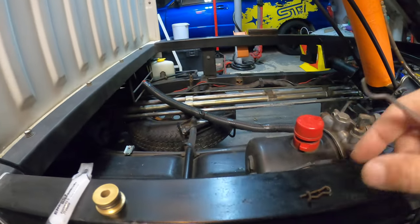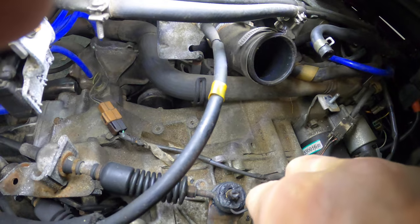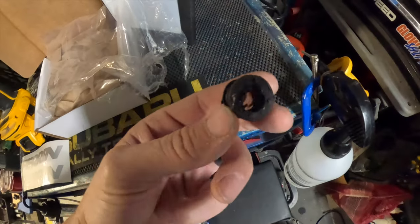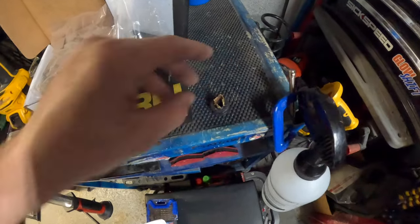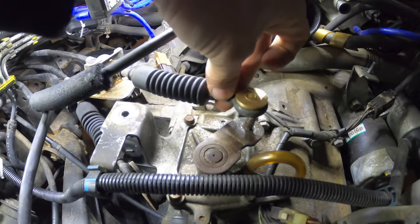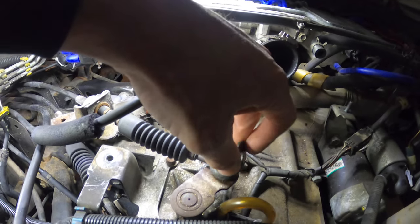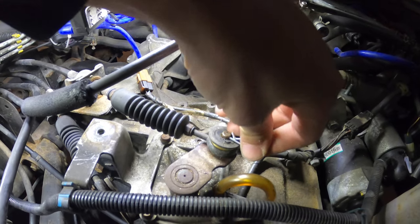I would not suggest doing that unless you know exactly what you're doing — you need to be an experienced grabber. I kind of made my own RTV. My bushing was shot. Here's the bushing, and then here was that little brass sleeve that it fit out of. I had to mangle it and cut it in the car. You want to press this into this, press this in on top, add a washer, and I got myself a new cotter pin — because why not.